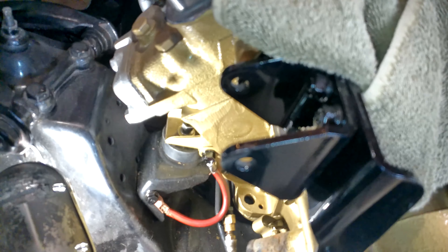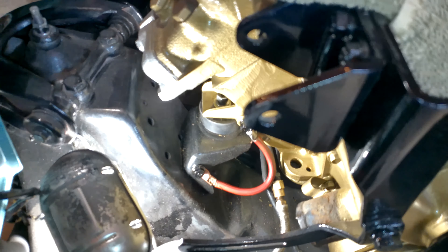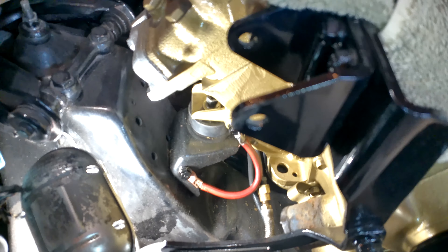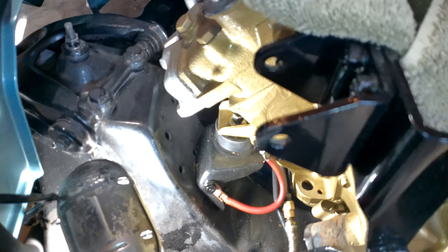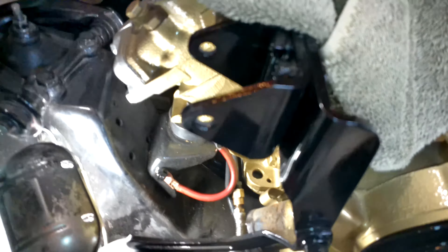While I was pondering that dilemma - because I feel like wow, if I tighten these all up, that means the one motor mount was broke. Does that mean there's pulling up on that rubber and it's going to break it after a while? So while I was pondering that, I discovered down here - see the steering control arm - it's rubbing on the front pulley right here. I can see where some of the paint is scraping off.